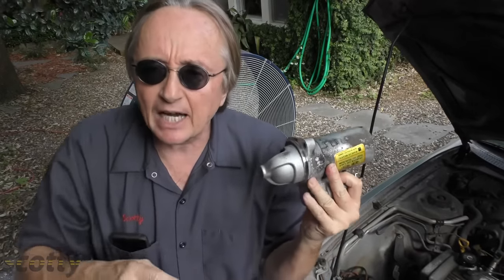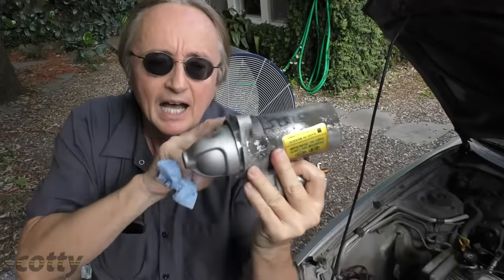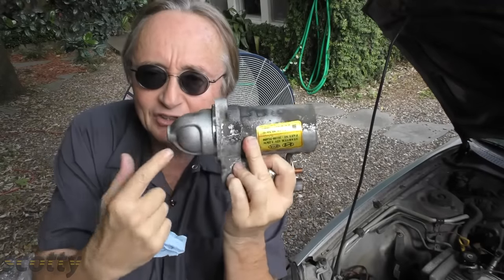They're making cars cheaper and cheaper, and they're not going to be putting more and more expensive batteries in the cars just for this. In hybrid cars they use giant motor-generators to start themselves up, but on a regular car they're using these tiny little starters that are not made to be used over and over again. Now granted, some of these auto stop-start cars do have a more robust starter, but it's nothing compared to the generators used in the Prius or any hybrid vehicle — these things are tiny compared to those huge ones.